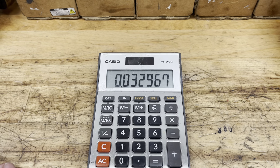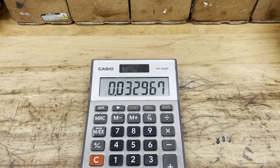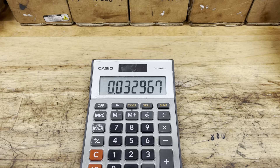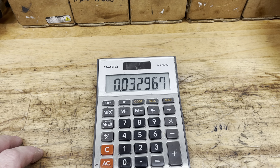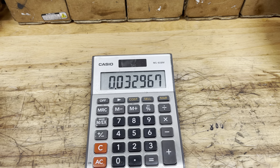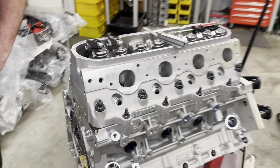We could go a little longer on that push rod. Ideally, on most of our engines we set them about 20 thousandths off the bottom. Remember, this is an aluminum block, so it is going to grow and that number will go up. These are Comp EVO lifters — they have about 90 thousandths of travel, so we'll have about 65 to 70 thousandths of preload on that lifter.